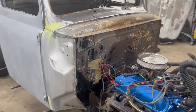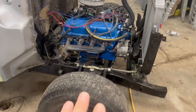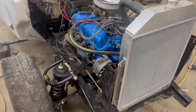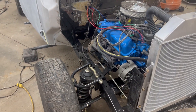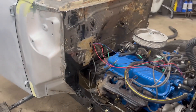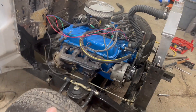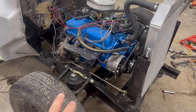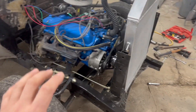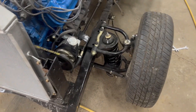I followed the instructions — you can see how beat up these are. I followed all the instructions perfectly for every step of installing this. What I ended up with was some damage to the ball joints. When I contacted CPP, they said it was because of the stress the suspension angles create. It took a couple of people there to actually come to a conclusion.